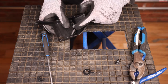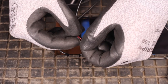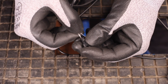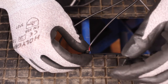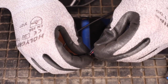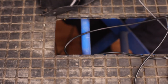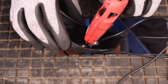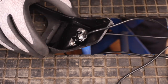We can now take our hot glue gun and seal the LED. While the glue gun heats up we will reinstall our connector — as always we want the black wire on the right side and the red wire on the left side. We can insert them and take our terminal extractor to gently push them in. As you can see they're locked in. We can now take our hot glue gun and layer it on to seal the LED in place.